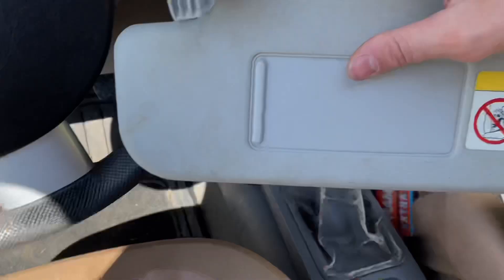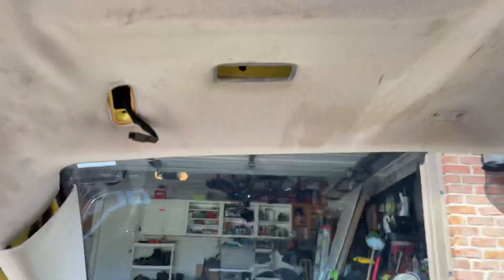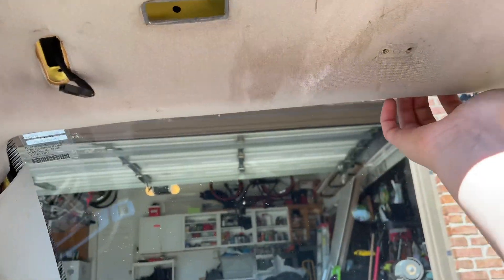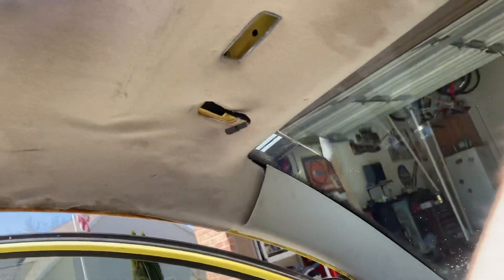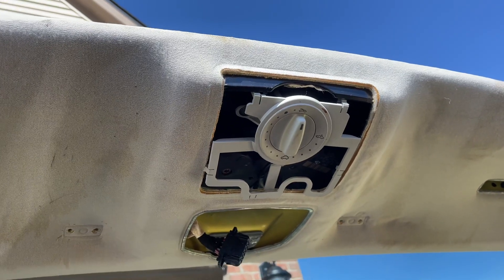Pop this part through, and once you get it all the way down and hung like that, you can just pull it all the way off, feed this wire through, disconnect the connector, and then you've got your driver's mirror assembly right there. Now this all looks loose for the most part. This part we're gonna have to disconnect as well — looks like it's just going to be a few of these connectors.